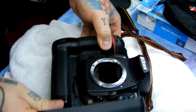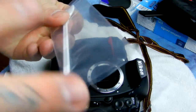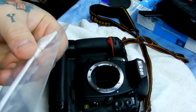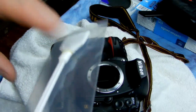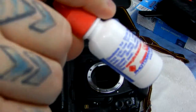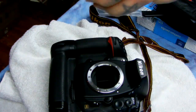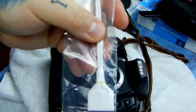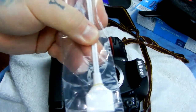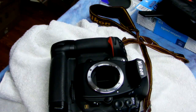I'm going to put a couple of drops — remember, I only use my sensor cleaning paddle once. I got the appropriate size, which is for a full-frame sensor. I'd never ever touch the tip. You put three drops on the end of the paddle, then you swipe, bend the stick, reverse it, turn around and swipe again — just like mowing the lawn, which is a perfect analogy. Press down not very hard but enough to bend the stick, then go from one side of the sensor all the way across, never letting up, turn around and swipe the other side.